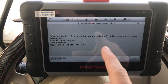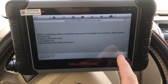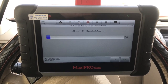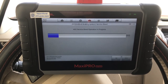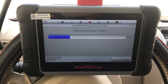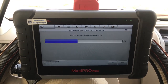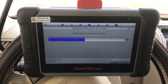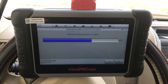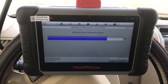It says to consult your manual, turn on the ignition, depress and hold the brake. So we're holding the brake and we hit OK. Lost brake pressure — pumped it back up, now it's firm. Lost it again — firm again. You can kind of hear it in the background, and then one more time.